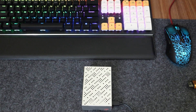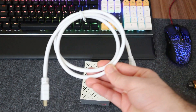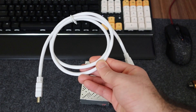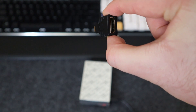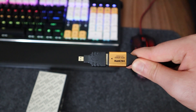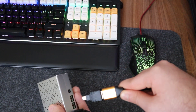Now, if you do have a monitor but don't have a micro HDMI cable or your micro HDMI cord is not long enough, there's an easy fix. All you need is an HDMI to micro HDMI adapter — I got one for about two dollars. Just connect your HDMI cable to the adapter, then connect it to your Raspberry Pi, and now you have your Raspberry Pi screen on your monitor.